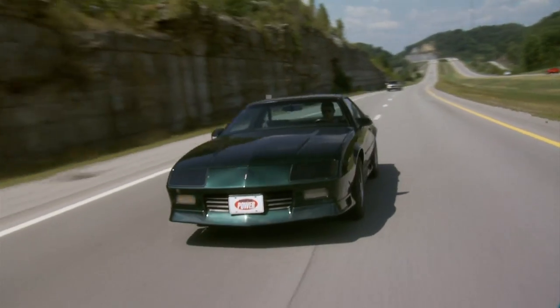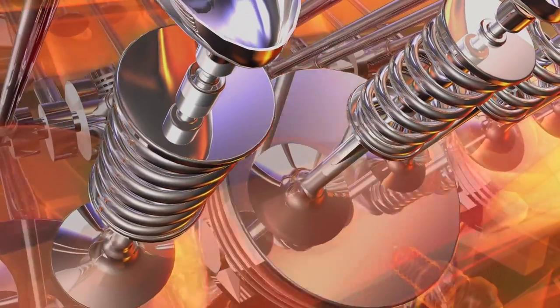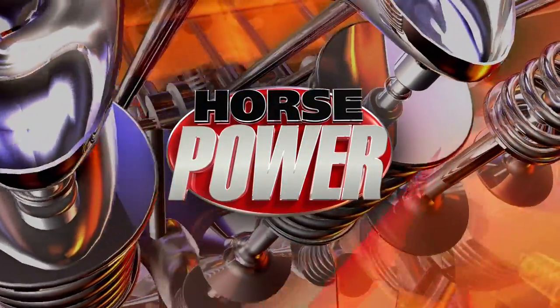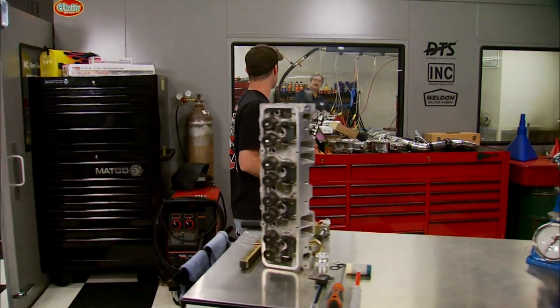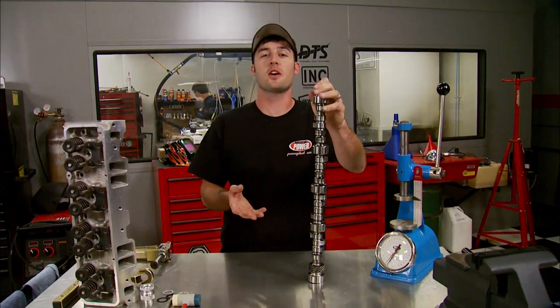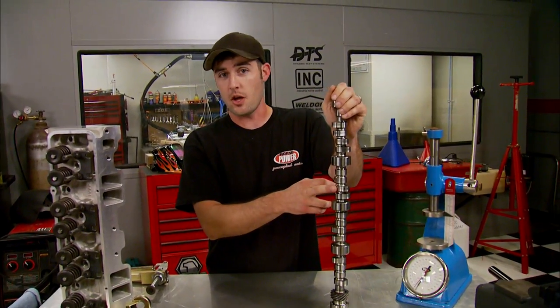It's so long to the Lean Green Street Machine. Now, the camshaft is often considered the brains of any engine, so you don't want to cause it or yourself any headaches when it comes to excessive wear on the cam lobes. It all starts by getting the proper valve height and spring pressures — it's not that hard to do and won't cost much but time. Let's get acquainted with the cam card that comes with your camshaft.